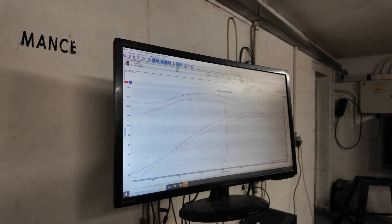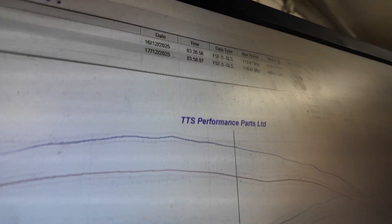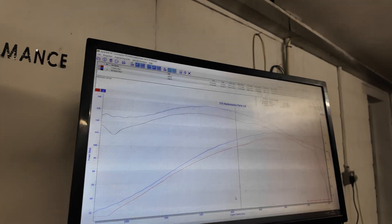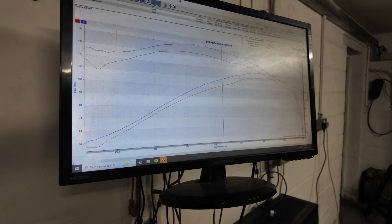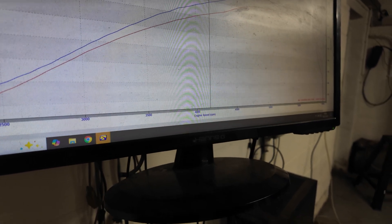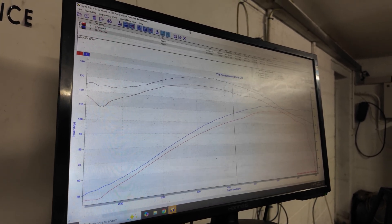With the original bike you've got speed limiters and RPM limiters — we've got rid of all of that, so it can go flat out to the red line in sixth gear without the throttle closing in the top end of fourth, fifth, and sixth. A lot of work to get it right — you're looking at five or six hours — because you're not just talking about full throttle horsepower, you're looking at all the intermediate throttle angle range to get it sweet all the way through.